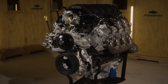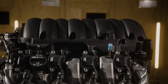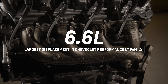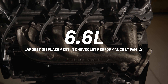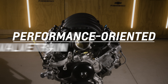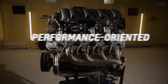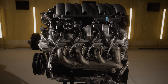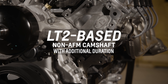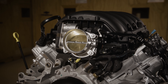The L8P is a performance variant of the L8T, the largest displacement engine in the Chevrolet LT family. At 6.6 liters, it's a behemoth. With the L8P, we added some performance characteristics to this workhorse. First, you'll find an upgraded valve train featuring more performance oriented valves and springs. Coupled to that top end upgrade, the camshaft from the LT2 gets fitted, offering a non-active fuel management profile that provides more duration. Basically, every cubic inch of those 6.6 liters is now optimized for performance on the track.